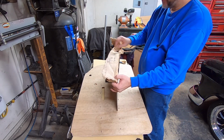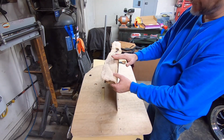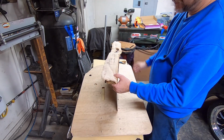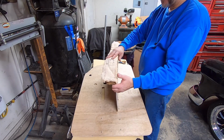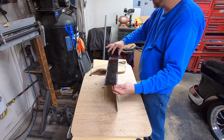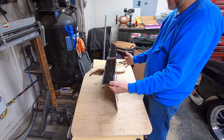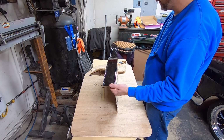But this cotton is very soft, so it'll squish a little bit. So that's why I'm using 1/2 inch sew foam. I'm going to take a piece of 1/2 inch sew foam and cut it to where it fits in here exactly and spray glue it down. Then I'm going to wrap the whole thing in 1/4 inch sew foam.